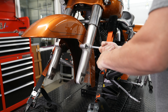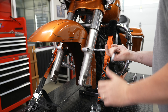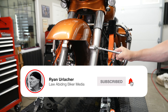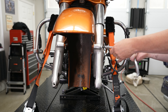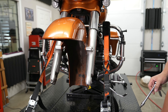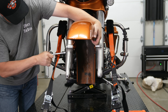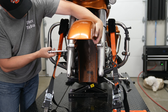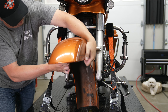With a quarter-inch hex head on a socket and extension, we're going to remove the fender from the forks. There are two bolts on both sides — on the inside you don't have to worry because those nuts are welded on, so you just back the bolts out. One on the back side of the fork and one on the front side. He's supporting the fender so it doesn't drop onto the lift, and now we can get that fender out of the way.